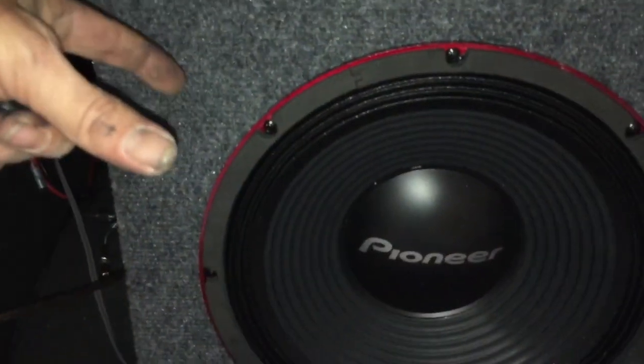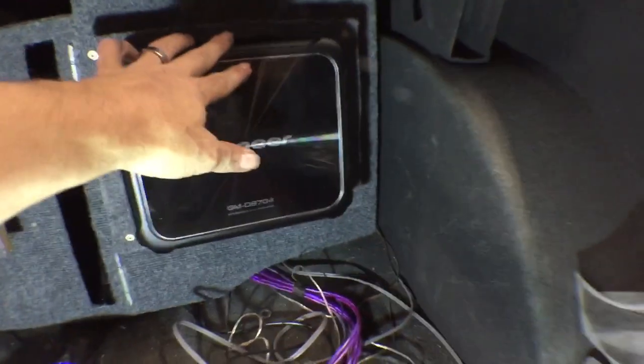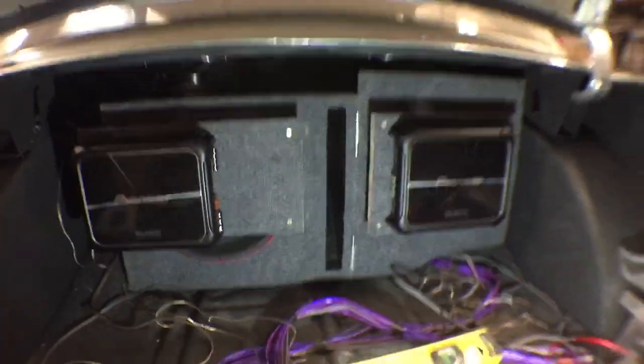She's all in there now. We're going to have to build some standoffs off this box a little bit. We're going to put our amp rack right there, mount our amps, start wiring stuff, and we're going to want to build a fascia board. It's a steamy one here. Alright, we got our amps mounted. It took me a minute to figure out how I wanted to do this — we've got that spaced off away from the sub. This has to be able to open to access the battery, so I put that on hinges. There's our battery back there. We'll put this so it latches somehow — put a screw in it or something. Then we'll build a fascia plate so all you'll see is the face of the amp and that's it. All the wiring and everything will be hidden behind.